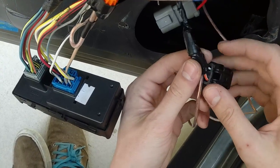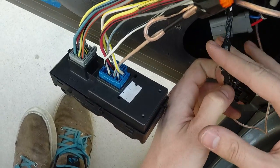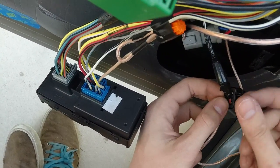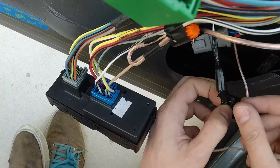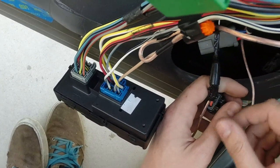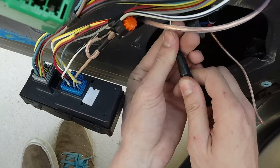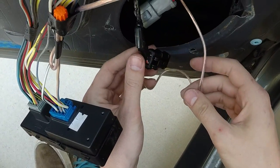We don't even need that wire anymore because it's only giving us half voltage and that makes our window not work. Unscrew this, cut it wherever you get enough room — I cut it back here — twist off another piece of wire, get a wire nut, wire nut and solder them again however you want. Then tape it up for vibration since it's sitting right behind the speaker.